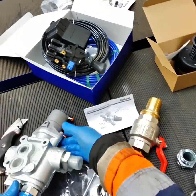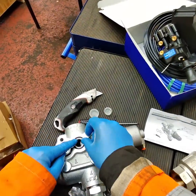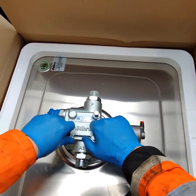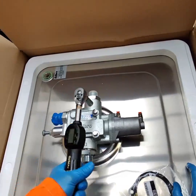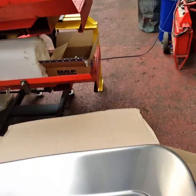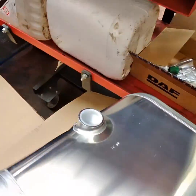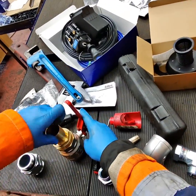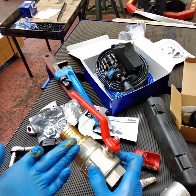Now onto the hydraulic tank. These tipper valve seals need to be oiled before fitment, and also more torque wrench action. Nice bit of liquid PTFE going on here as I hate leaks. This fitment with a lock nut and an O-ring is such an improvement on their old design.